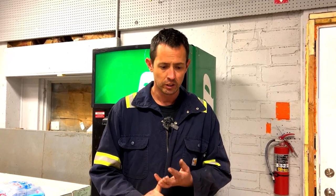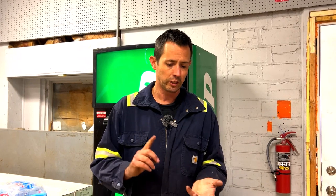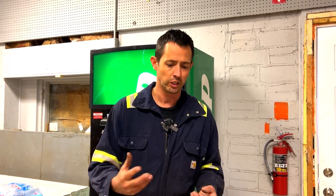On the computer, we're using the Snap-on ProLink Edge Ultra, the newest Snap-on ProLink they have. First I went and did a DPF DOC reset, and that enabled us to start and initiate a regen, but it kicked out after about five minutes. So I went back in and did a DPF filter installation — basically like saying I put a new filter in. Did that, went back and reset, and then it actually went through a full regen cycle. It's been running out there for about an hour and a half — soot level is down to zero, normal level — and our differential pressure dropped from almost five inches of mercury down to about half an inch of mercury.